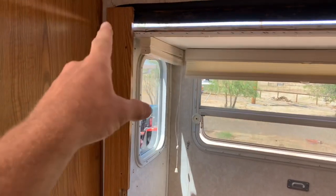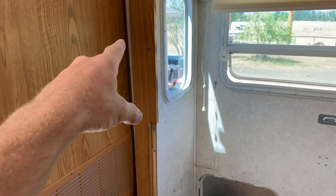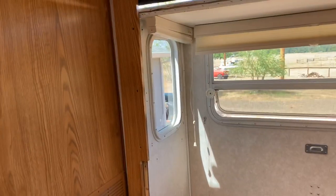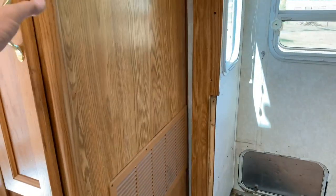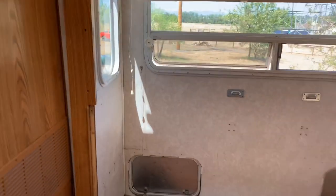So let's go take a look on the inside. The issue I was having is all the molding around here — you can see I've got the top piece off — but there are aluminum angle pieces that these faux wood pieces are screwed to, and it's screwed to the back side of these boards and to the sidewall of the slide-out. You can't get to those from the outside or from the inside, because there's no room on either wall. You've got the bulkhead on this side and the wall for the furnace and pantry cabinet. There's just no way to get to it. So I'm taking off that outside molding and I'm going to run the slide-out in.